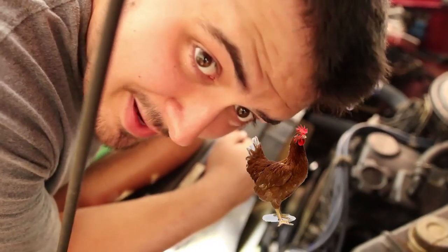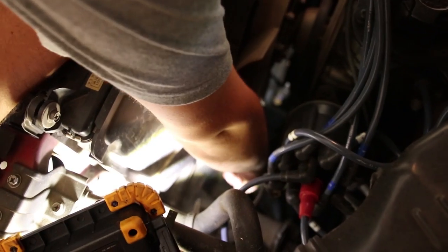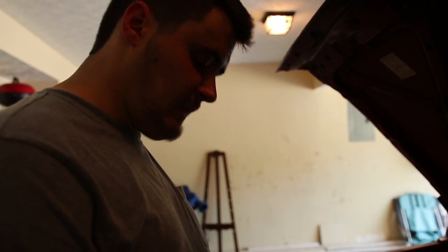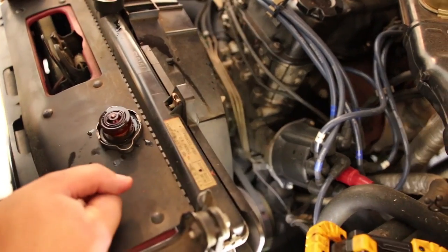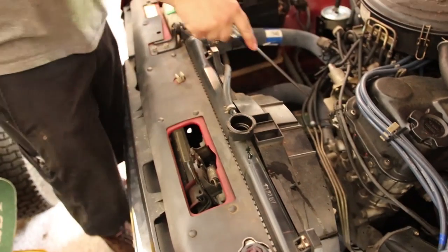First step - play with your petcock. You've got to find it down here. That's what you call a radiator drain plug. There's a hose right here if you have an original unmolested engine. You're going to turn this little knob right here on the bottom of the radiator to the left and it's going to start draining coolant. To make it drain faster, take your radiator cap off - you release the back pressure, like taking your finger off the top of a full straw, and it'll drain a whole lot faster. While that's doing that, we're going to go ahead and take this hose clamp off.